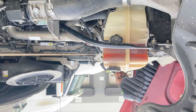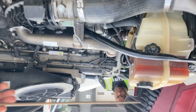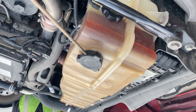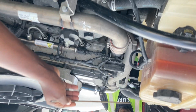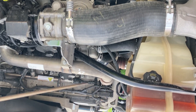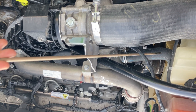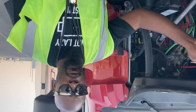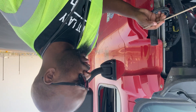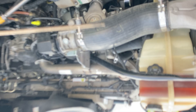Starting with the coolant reservoir: it is properly mounted with nuts and bolts present and tight. It is not cracked, broken, or leaking, and is at a good operating level between the minimum and maximum fill line on our sight glass. It also has a good cap that is not cracked, broken, or missing — the seal is not cracked or dry rotted. My coolant reservoir hoses are all properly mounted with clamps that are present and tight. I use the A, B, C, D, L method with hoses — that means abrasions, bulges, cuts, dry rot (because it's rubber), and no leaks. That applies to all hoses.